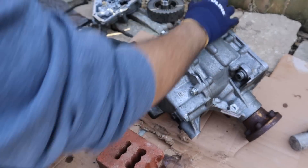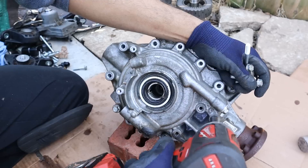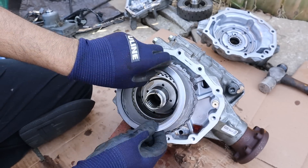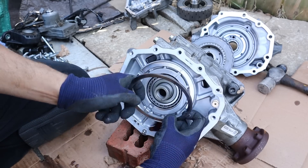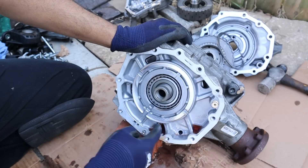I'm going to flip this around and do the same thing to the left side. Pop this out — same thing as this side. We've got a little bearing on the inside here, and there's a thrust washer here. And then here we've got the internal spline for the left side shaft. I'll just remove the clutch pack, and there's a thrust bearing here too. The oil quality looks pretty good but it's not as thick as that gear oil you usually put in a differential — it's a bit thinner.